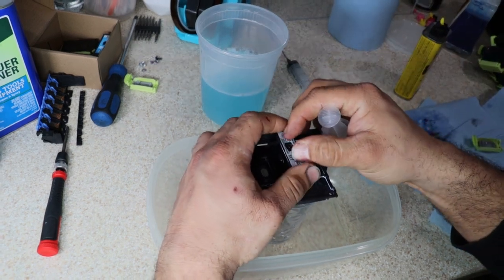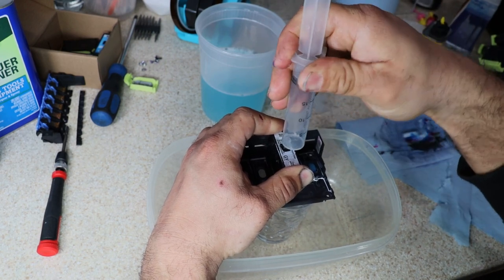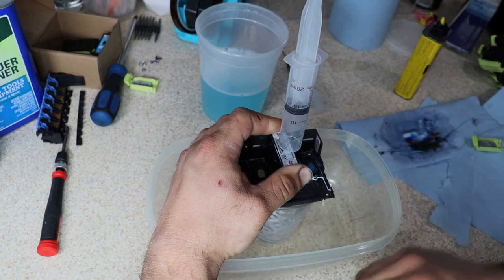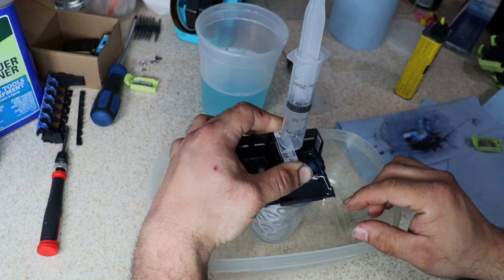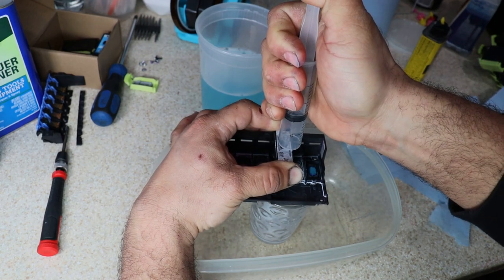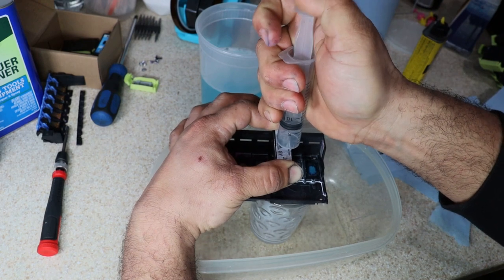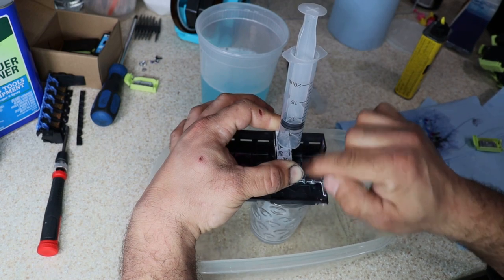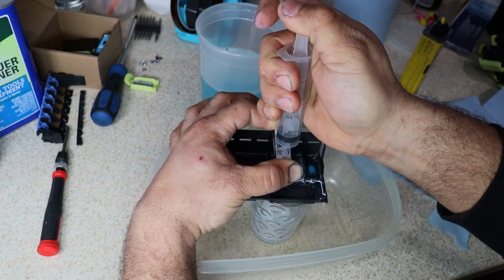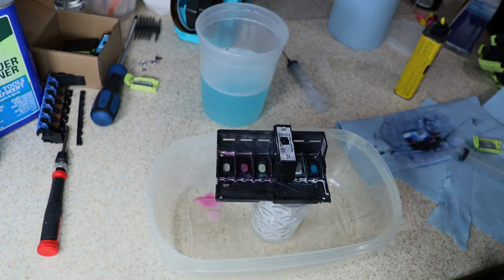The key is not getting goof off anywhere other than just the top and the metal portion of the printhead. You don't want this to get on the electronics. Now we're going to push really hard. We need to make sure that we have a good seal. As I'm pushing down, I'm going to grab an empty syringe, wedge it here on the top, and push down. What you want to see is dripping on the glass — you can probably see all those drips getting into the glass. That means solution is going through and that's what you want to see. Just slowly keep putting pressure. Don't let it leak. Don't let it get air on the sides because solution will go everywhere. I'm hearing air, so I'm going to remove this and relieve a little bit. We're going to go for round two.